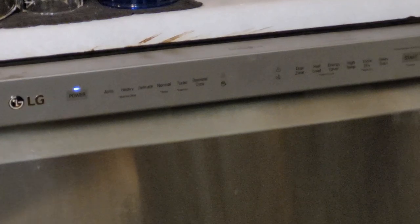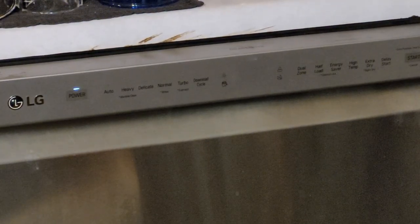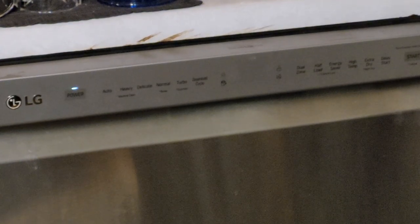We've had it running about two months now, probably done about 10 or 11 washes. Now we're getting a new code — as you can see, it's flashing right now. It acts like it's pumping but it's not. This is what's called a leakage error. It could be a door gasket, but in this case it's not — the float assembly is stuck, and you also have the controller issue. What we've found is it's actually the float assembly that's stuck.